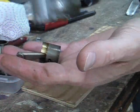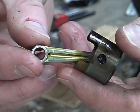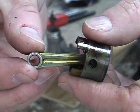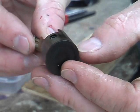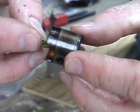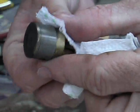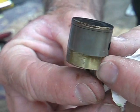Piston is out. Looking at the conrod, you'll see it's actually different on one side to the other — that's why we made that little mark. It's also a good time to check the piston for damage. This one has done 380 hours — there's only a small amount of carbon build-up and a fairly nice even smooth wear band around the top. This is an ABC engine so there's no piston ring to worry about. Just check there's no scuffing, cracks, splits, or damage — this one is in pretty fine shape.